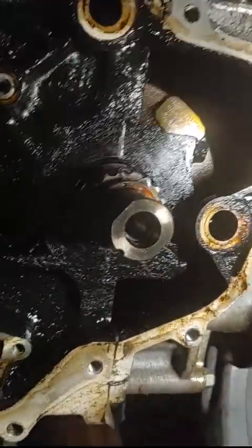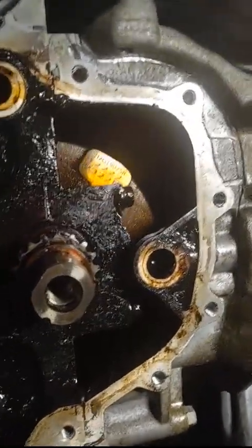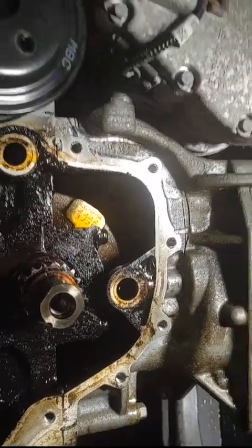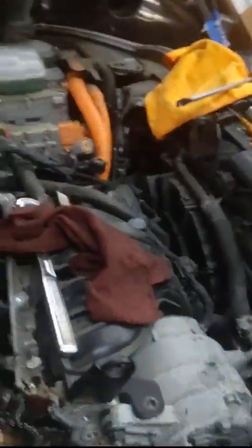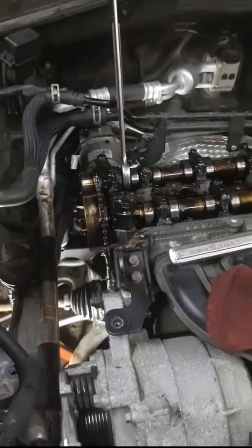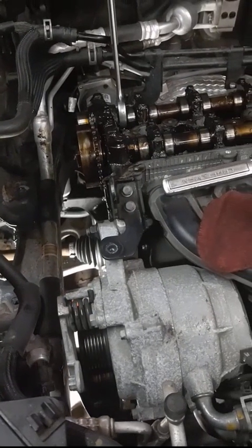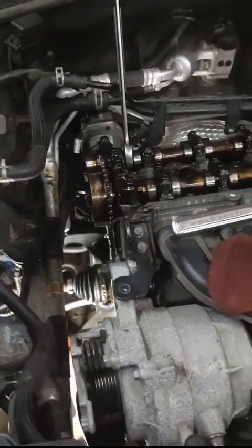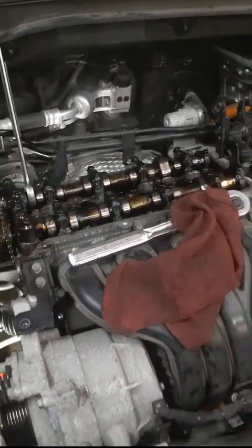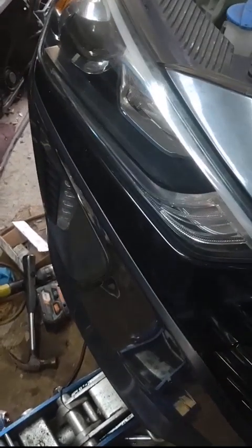No keyway means this is probably going to be heated to come off - the bolt buster should do it and it should slide off. But how do I know where to put it in the right place? You'd have to make reference points. They probably want you to pull the number one spark plug, bring it up to top dead center, and possibly use a special tool to measure it perfectly. It may be better not to touch it. I need to buy engine degreaser. I also decided to weld that thing for you - it came out okay, I ended up painting it.